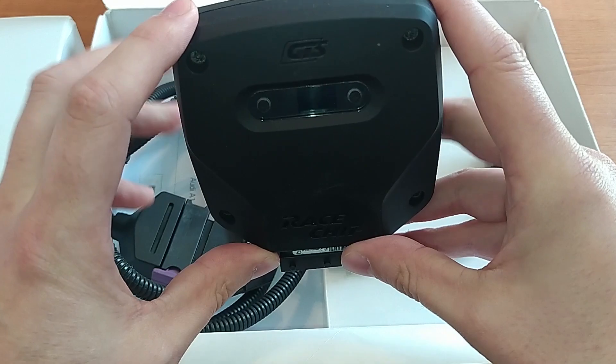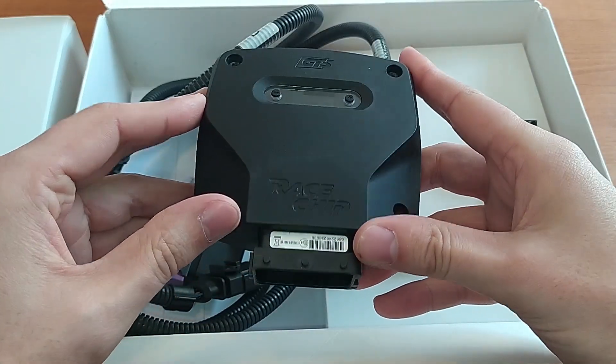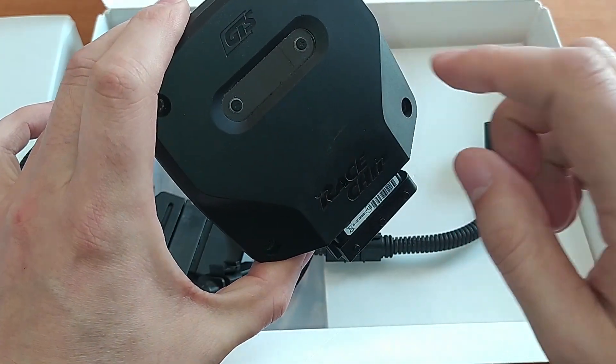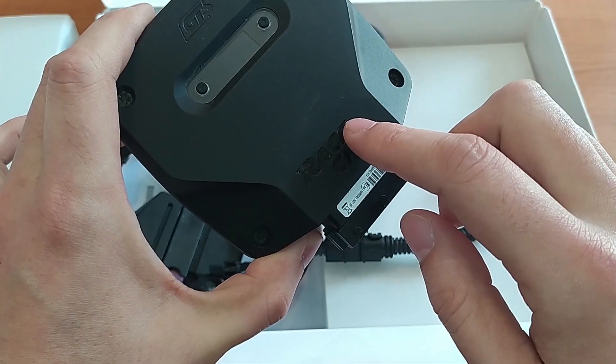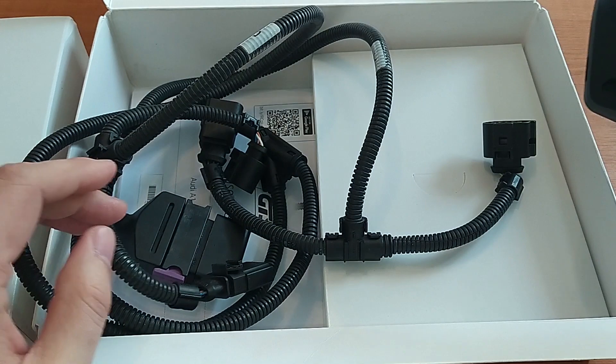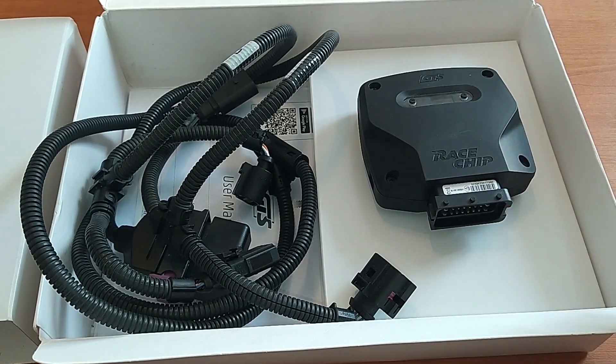This box acts as a digital middleman — this little black box controls and manipulates the information going to the ECU in an attempt to gain more power. To put it less dramatically, the chip basically under-reads the boost and manifold pressure values to trick the ECU into compensating with more boost and more fuel to create a bigger bang in the cylinders. The problem with this approach is that the trickery will only go so far, as the ECU software will only accept sensor values within a certain range. If you under-read the boost pressure too much, the ECU will simply throw a fault code — it will find it implausible for the engine to need as much fuel at 3000 RPM as it would at 5000 RPM. So there are limits which this thing cannot overcome.